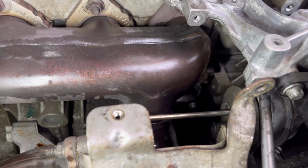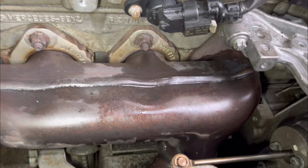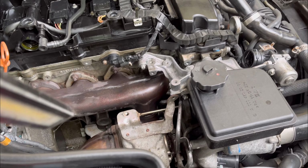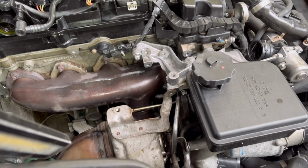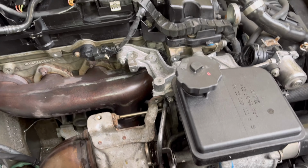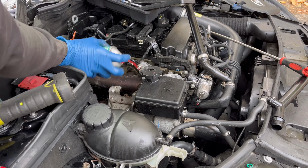So what I'm gonna do next is clean all the oil around the leaking area so that I know there is no oil around there. Then I'm gonna connect the coolant hose and the vacuum hose and start the car, just to look out for any oil leaks. Then I can put everything back together. I just wanna be sure, because I don't wanna put everything back together and then there will be a leakage. So I think that's gonna help me. So let's do this.